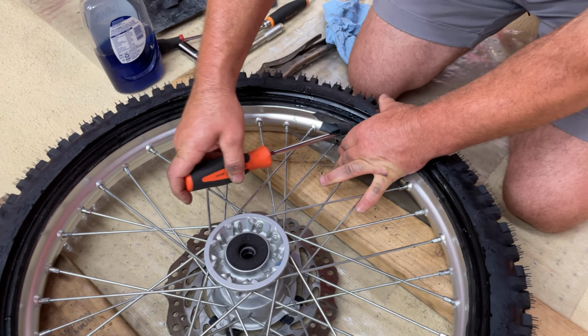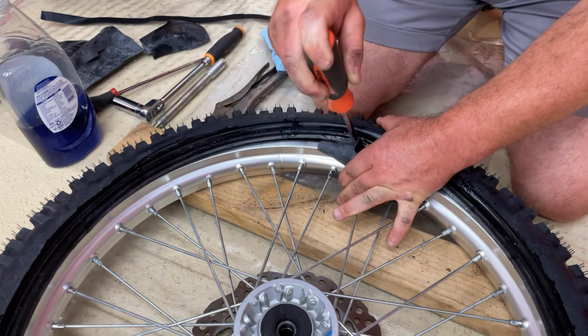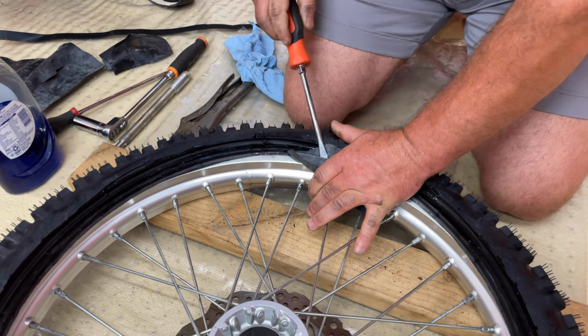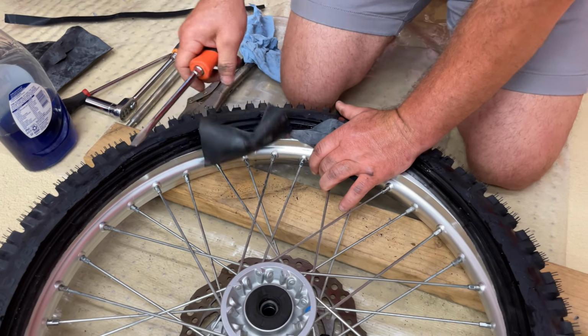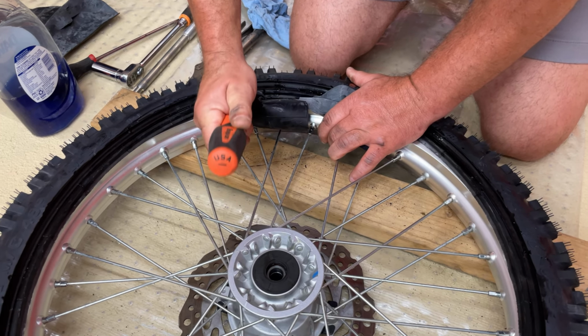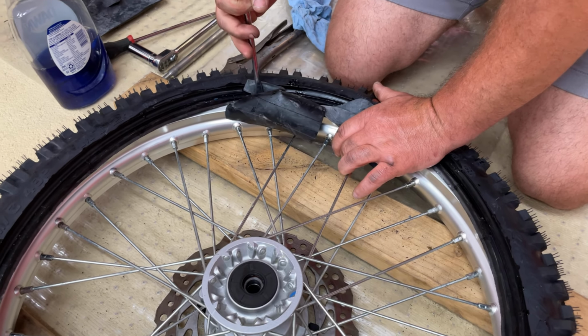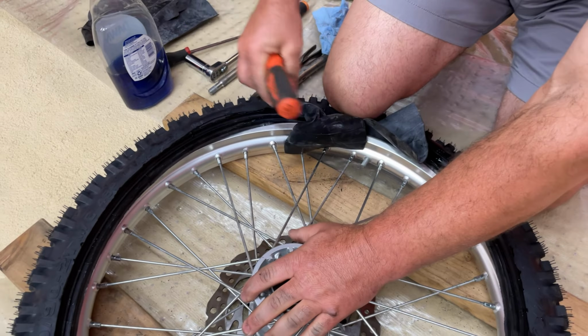Let's push the rim lock in by hand and make sure it's up. You can see my fingers pushing it in there. And let's try to pull this up and over to get it up in there. And then I will do that one more time just over here very carefully. We don't want to get that tube. All right, and now that that's